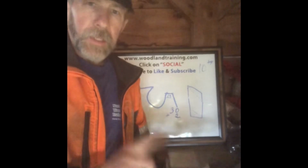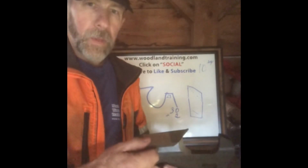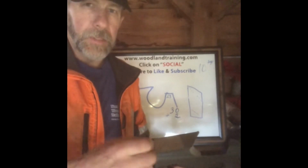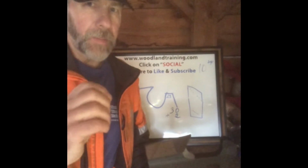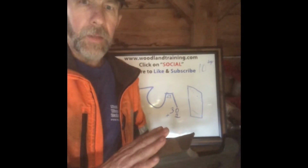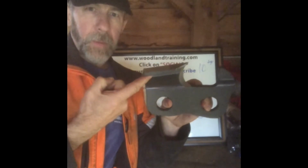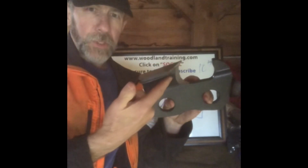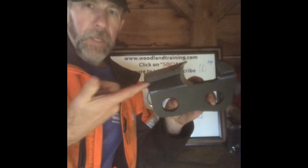So by taking that out, we're going to do 2 things. One, we're physically taking some weight out of the chain. It's minuscule, but it's something. Take that metal out of there. But more importantly, it's opening up the channel for the chip to slide out from under the tooth. That's where that chip goes.